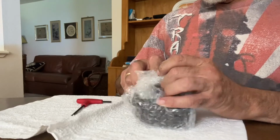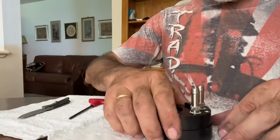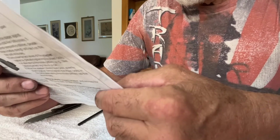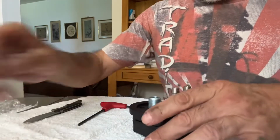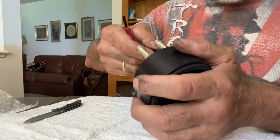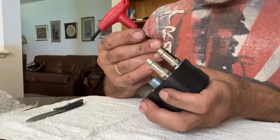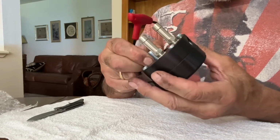Here I'm looking at the new oil filter adapter plate. The instructions are very clear on this process. We were supposed to remove 5 bolts with a 5/32 Allen wrench, and separate the two parts as you see in the little video here. And once you have it separated, you have to remove one of the big oil hoses out to install the next piece, which is called the street T pipe fitting. You'll see that in the next segment.